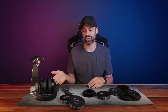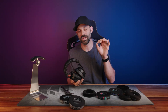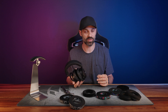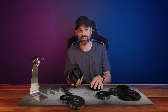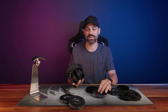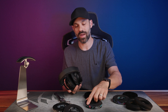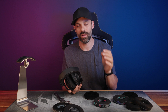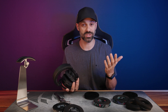The Beyerdynamic velour pads on the Tiger are notoriously shallow and have a padded center baffle, expecting your ear to press against it, which causes discomfort for some people. The freeze pad doesn't completely eliminate ear-to-baffle contact, but now my ears are just barely kissing the driver baffle rather than being compressed — that's the most significant comfort improvement. Velour pads don't make you sweat much but get warm quickly. The freeze pad has higher thermal mass so it takes longer to heat up, but also longer to cool down. I actually enjoy the sport fabric feel more than I expected.